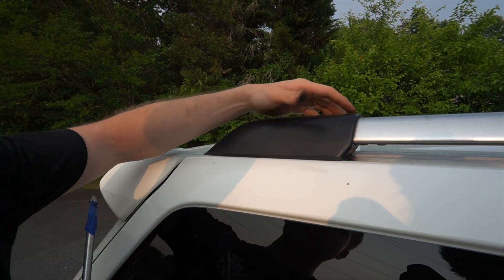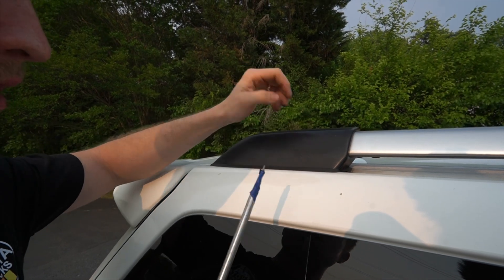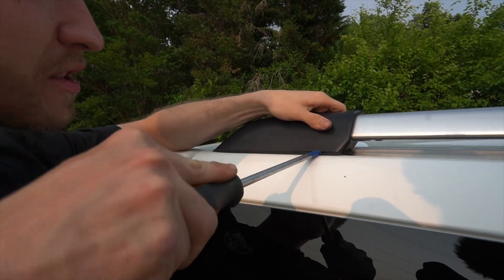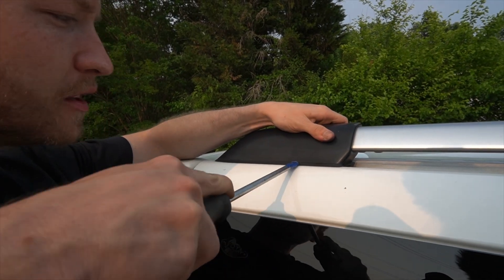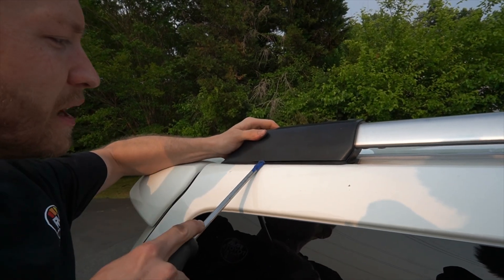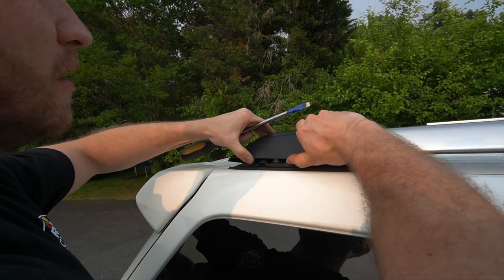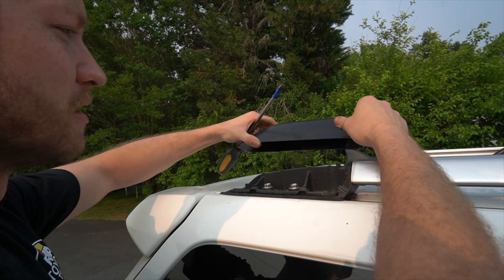If you try to remove your front caps you're not going to have enough room to squeeze these plates in there, so you actually have to remove the rear ones. We're just going to take a screwdriver — normally you want to use a plastic one to protect from damaging, but I just put a little blue tape on this one and it'll work. Basically you just get the screwdriver under there and pry up a little bit until you find the spot. You can see how it's popped up, then just work your way down until you find your other clip and roll it back until it pops off.